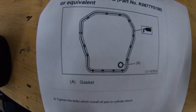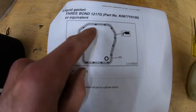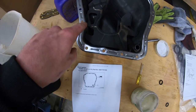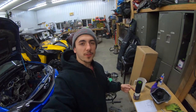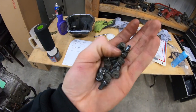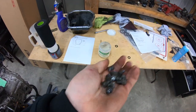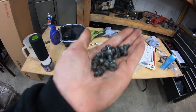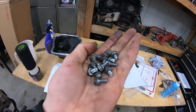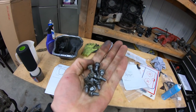Just to show the silicone line — go in a big circle around it, as long as you're on the inside of the bolts going in a path like that, you should be good. One more thing before you get the oil pan on the engine: look at your OEM oil pan bolts — there's going to be a whole bunch of silicone and grossness on them. Take them to a wire wheel and clean them up. There's no more silicone on the threads now — they're nice and clean.